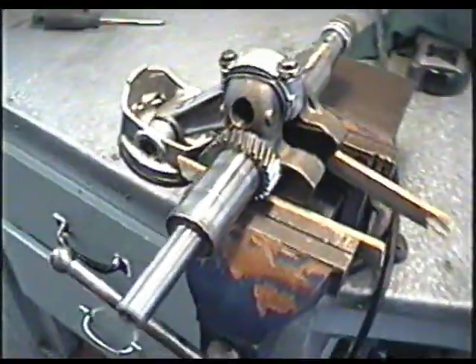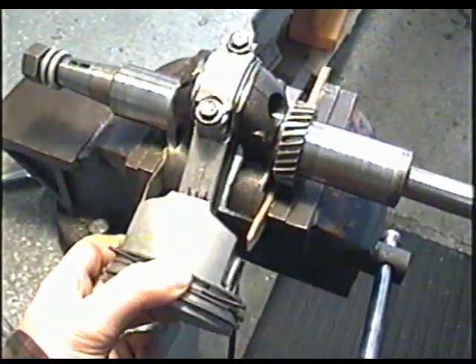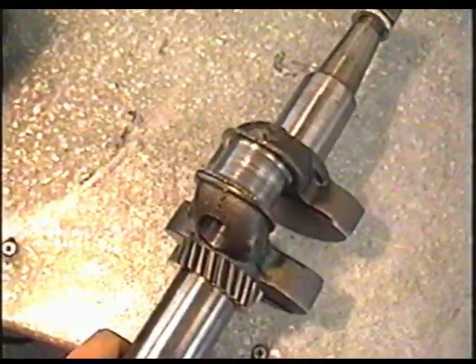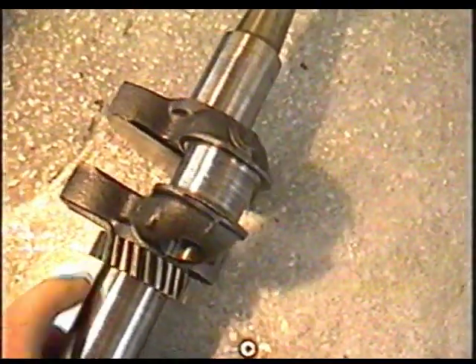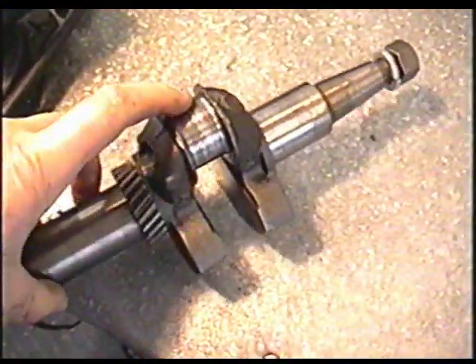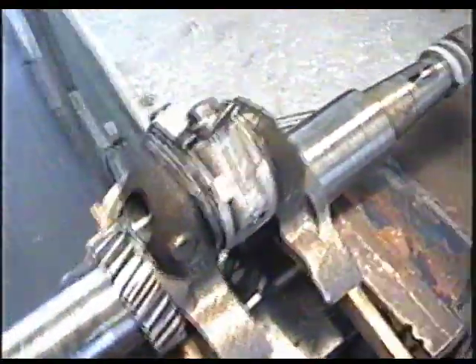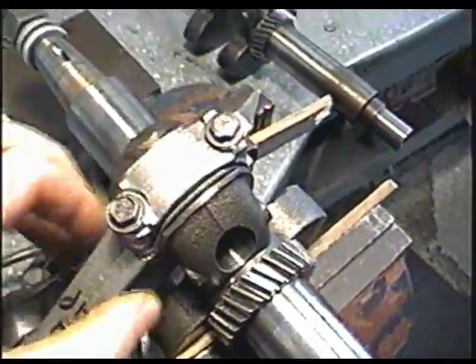The guy told me that this motor had been rebuilt — that it blew a connecting rod and then they replaced it. Now here's another crankshaft. Sometimes when you blow a connecting rod there's going to be residue of aluminum from the rod on the shaft, and sometimes you have to file or sand that down. What I think happened is they filed it down way too much.